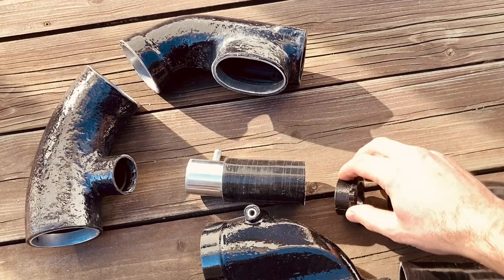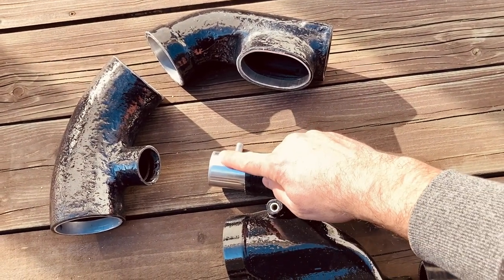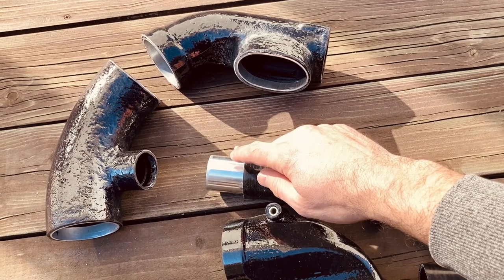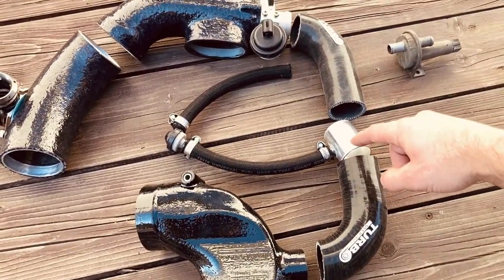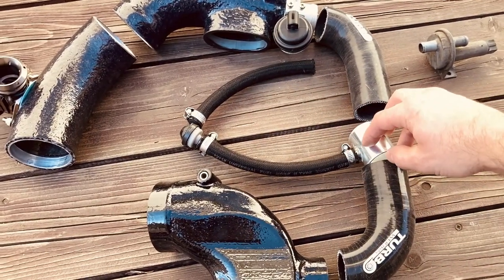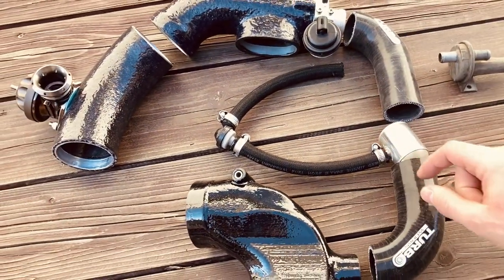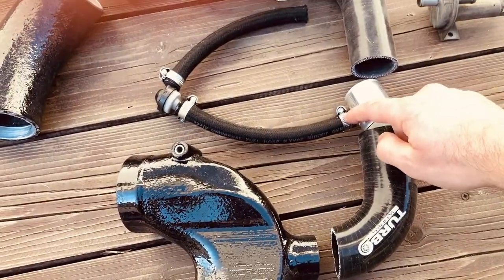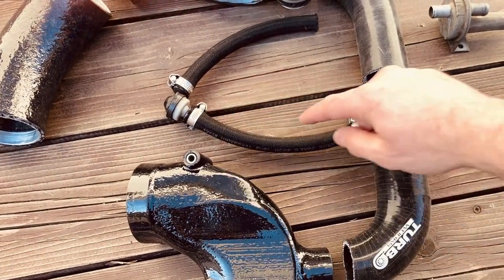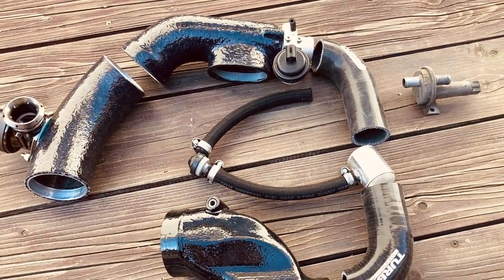On the V1-to-V2 upgrade: the old straight bit of hose is not needed. The T that used to feed the idle valve will be relocated from the crossover pipe to in between, and you'll get this whole assembly pre-assembled — you just need to connect it to the idle valve. Those upgrading to V2 will have to reuse the one-way valve from V1. Pay attention that the gray side of the one-way valve faces the T — just look at this picture and you'll understand.